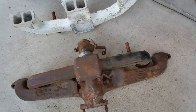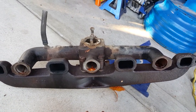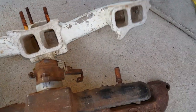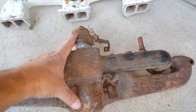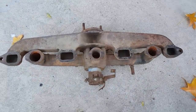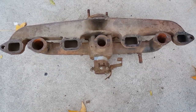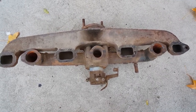This is what your intakes would look like. That's the Siamese port intake — you can see the three little funny ones in the center. Then this would be a later model with six intake ports. This one is magnesium and these are cast iron — very heavy. This one also has the spacer and heat riser. On the older style, they didn't even separate the center exhaust ports — they just ran into one port slightly bigger than the outer ones.